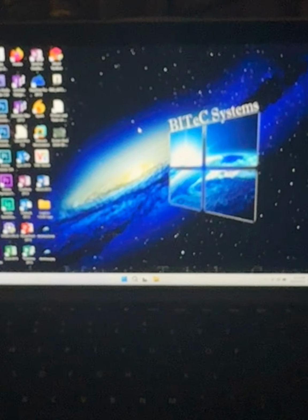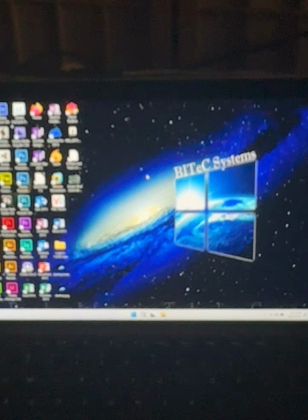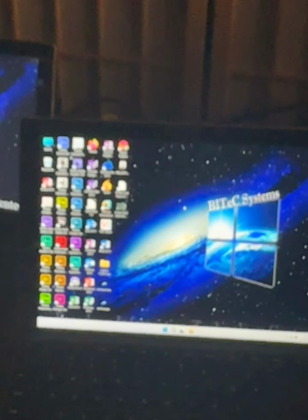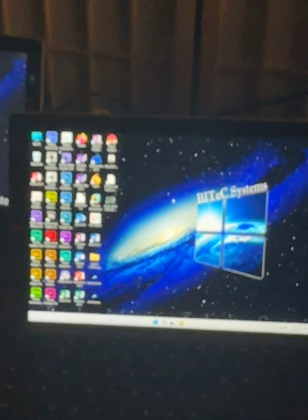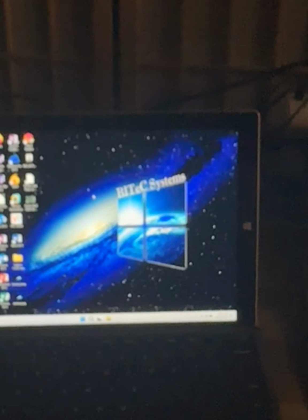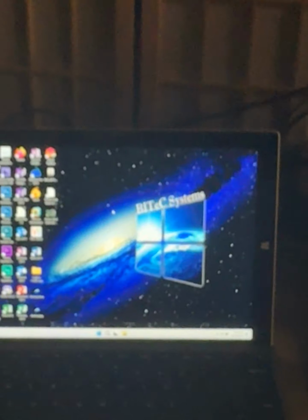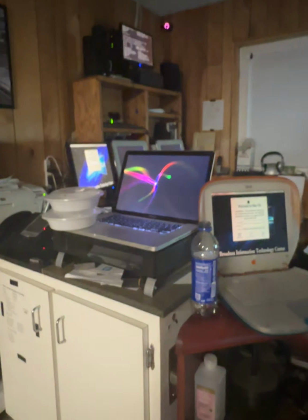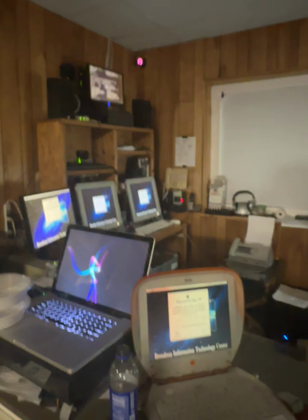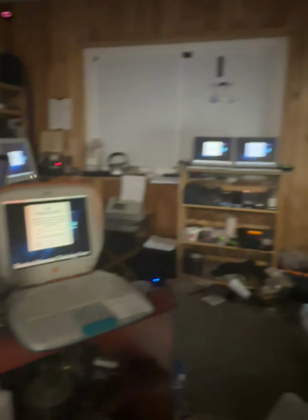And then that works. So really, because the Macintosh stores the home folder on the network, and I just map to that home folder from the Windows machine. And that's basically how that works. The file server runs Linux, so it's compatible with SMB here on the Windows machines, SMB on the modern Macs, like these iMacs or that MacBook, AFP on the older Macs, that's Apple Filing Protocol, and also Apple Filing Protocol on the OS 9 machines, and AFP over here on the PowerBooks.